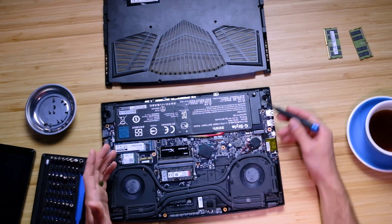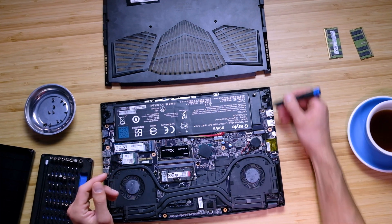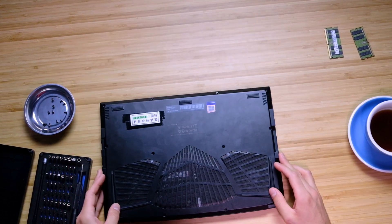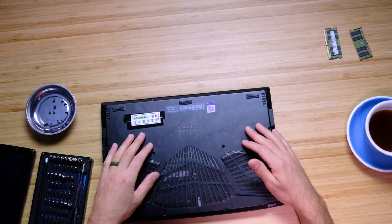And you're good to go. Switching out an SSD can get a little more complicated because you have to make sure Windows is downloaded to it or the drivers are set up correctly. So if you have two bays, I recommend just adding an SSD to your machine rather than swapping it — this laptop offers that opportunity where you can add an SSD rather than doing a full swap. From there, just put your bottom cover back on, reattach all the screws, and you'll be good to go.